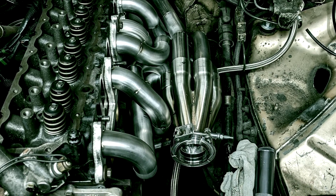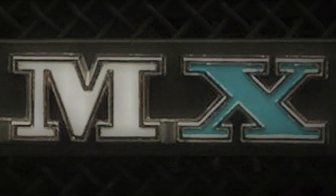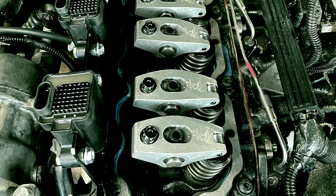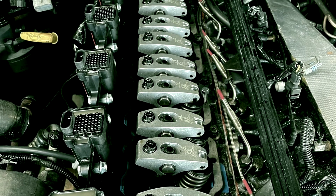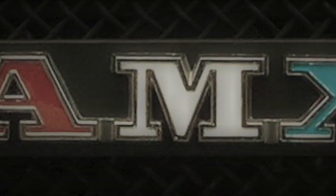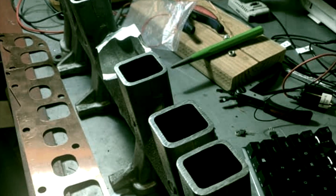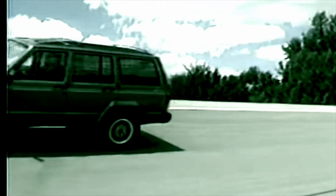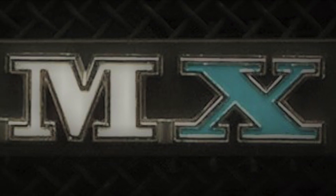We've chatted before — you've told me about a couple different cylinder heads that you're particularly proud of. The best casting to use is the 92 or 93 NH head. NH is New Haven, and it'll have it cast right in the head. If you look down between a couple of the rockers, it'll say 92, 93, 94, 95, and it'll say either New Haven or Tuffy. You don't want to use a Tuffy head if you don't have to. I would use the 92 or 93 4-liter head, New Haven. And also it's not the D-shaped port — it's the tongue-type port. You can see the exhaust port. The 92 and 93 has got the tongue-type port. Everything about the 92 head is the best.